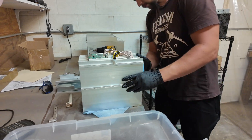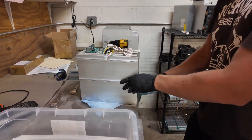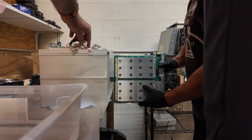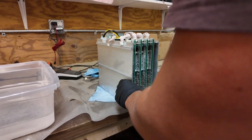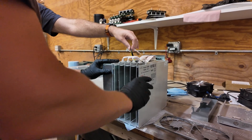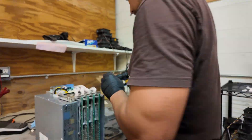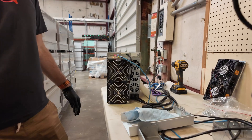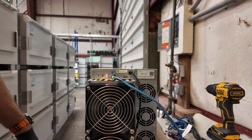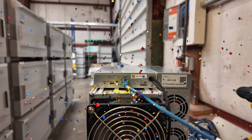After the hashboards and power supply are done, we'll clean the surface of the miner with shop towels and some solvent — on the inside, the outside, and the control board — just to make sure we got all the fluid off. Meanwhile, the power supply and hashboards have dried, so we'll go ahead and put the hashboards in to make sure they're properly connected, then do the power supply. Once everything's connected, we just want to test to make sure the miner is working — wait for the little LEDs, and after a few minutes we should see a green light. Now the miner is clean, mining, and back in air mode.